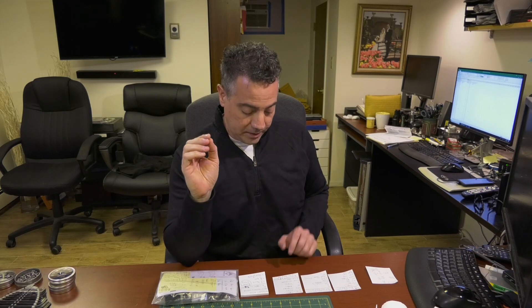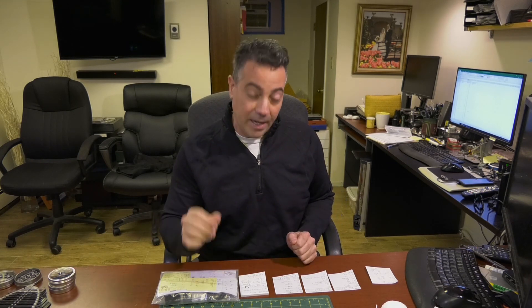I first reported that the 21-grain pellets were doing 940–950 fps with a half turn on the regulator and five shims — that includes the 2×0.05 for one tenth of an inch plus three factory shims — with no drilling of the ports. After a day or two it dropped from 940–950 down to about 910 fps. Then I left the half turn on the reg and five shims but drilled out the ports, which brought the H&N Barracuda Match up to about 935 fps.